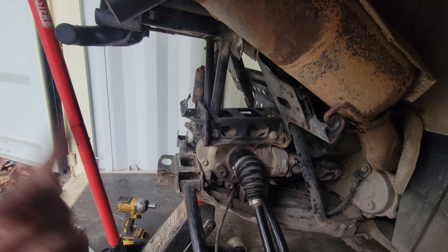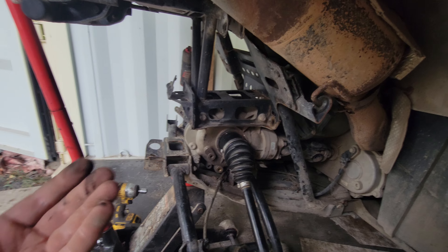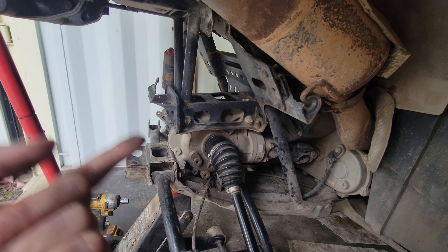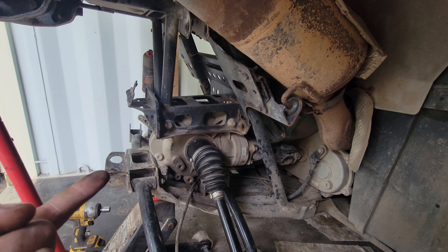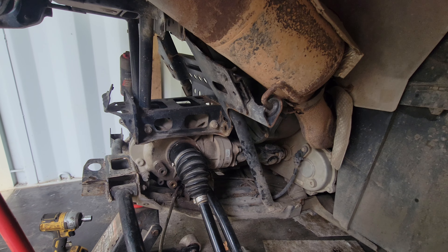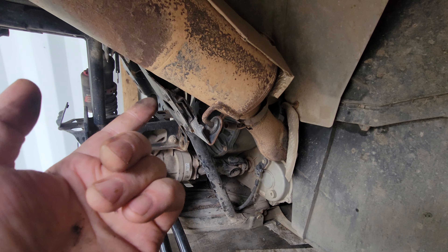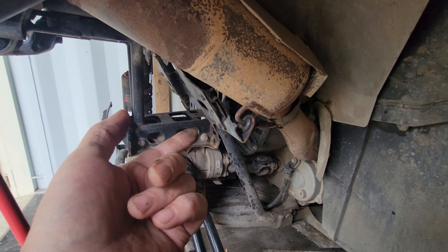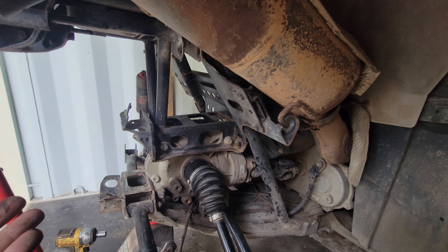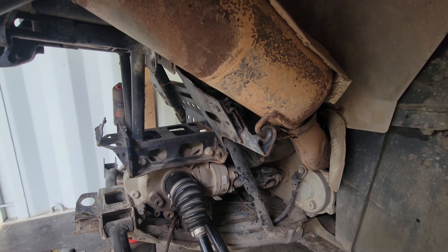With that being said, I have 27,000 kilometers on this and I've changed the bushings three times. This is the third time I've replaced the bearings. I'm about to put my original belt back on because it only has 10,000 kilometers on it. This other belt has 17,000 kilometers on it — that is unheard of. My clutches have 27,000 kilometers on them and I've never serviced them. People change these clutches out at 5,000 kilometers.